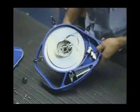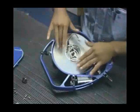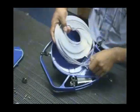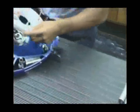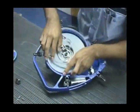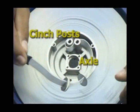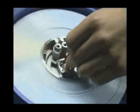To help remove the tape, reel out several turns of the handle to slacken it on the hub. When installing the new tape, leave about 20 centimeters or 8 inches free on the internal end. Loop the internal end snugly around the cinch post and, without any twists or sharp bends, pull the loose end through the axle hub.